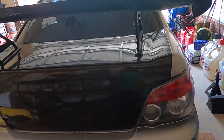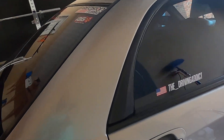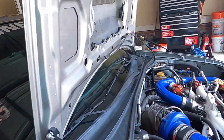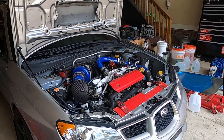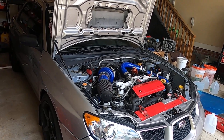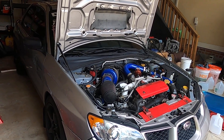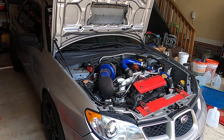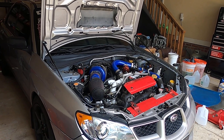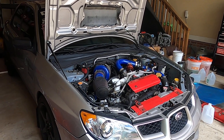After I had finished applying the JB Weld, I realized I could have simply ripped the heat shield off and been perfectly fine. But live and learn — the heat shield is back on with JB Weld, which can hold up to 550°F instant and sustained, who knows. So I may have a problem again come track time, but we shall see. Happy to have that done.